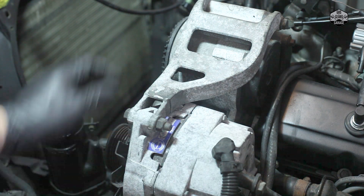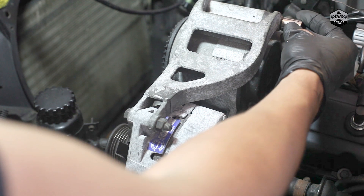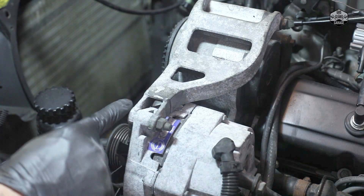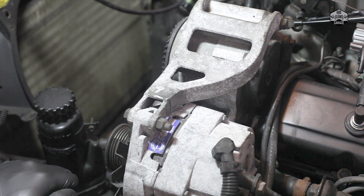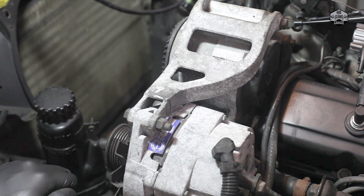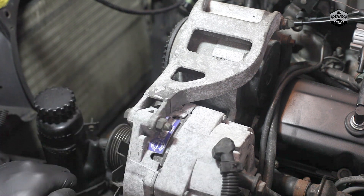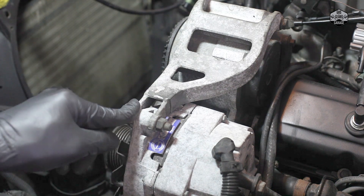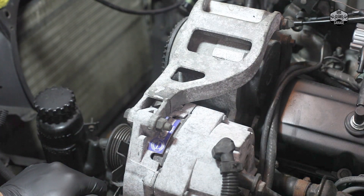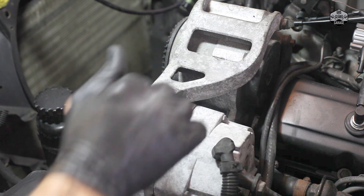One of the things you're going to notice is we're looking at two varying hex bolt sizes. The ones up here are using a 13 millimeter. This one down here is using a 15, and likewise for another one down here. So we're talking about a 13 here as well — this is the only one using a 15. In total we're talking about six bolts, and there's one down here towards the alternator that I'll show you right now.